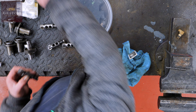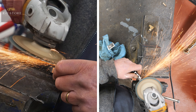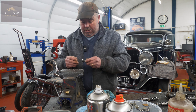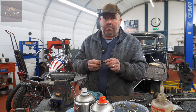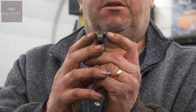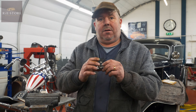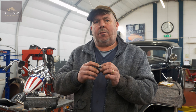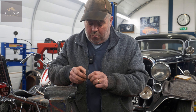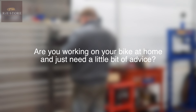So what you've got to do first of all is grind off where it's been smudged over. Just take your normal grinder and smooth it out. So that's that ground. Then you try and punch them out. If they won't punch out, sometimes you have to put them on the press, but what you've got to be careful of is compressing those two sides - then you won't get your new roller in. There's no real tolerance issue with a little sideways slop, but you want to get something like a small socket or small bit of tube that will allow you to tap that through.